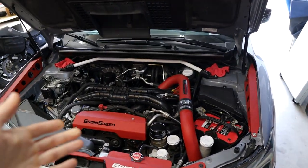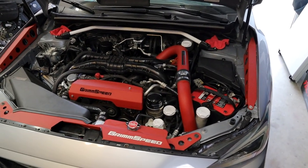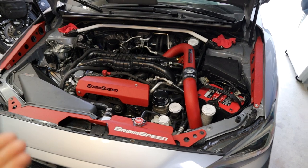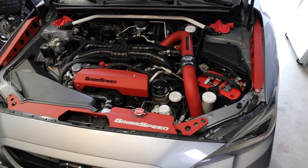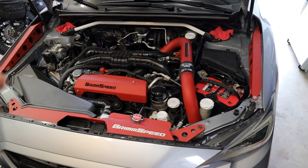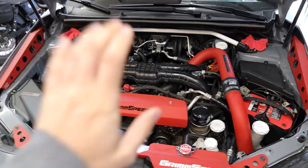For those of you who want to know power figures — this car makes 405 wheel horsepower and 385 lb-ft of torque on ethanol with the front mount intercooler. Those numbers are normalized to sea level. Up here in Colorado where the air is thinner, we have less oxygen and don't make as much power — probably a 15 to 20 horsepower loss — but because it's turbocharged, you don't see as big an effect at altitude. I got the car tuned here at altitude and it has been running absolutely beautifully since.